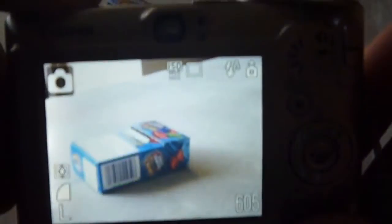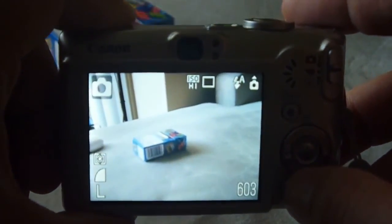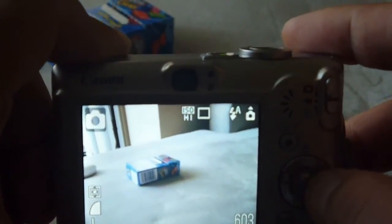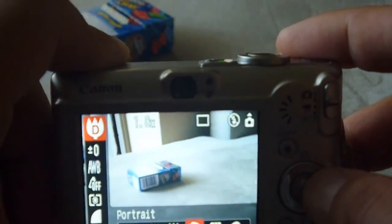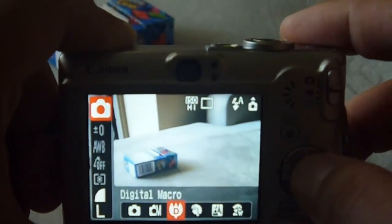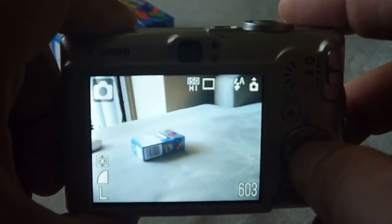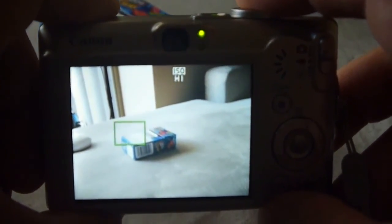Now when I take pictures it zooms properly. I don't think you'll make this mistake, but sometimes it's as simple as just what mode it's in. I made sure it's not in the wrong mode — in this case it was digital macro. I just press the middle function button, go left two times, and choose auto. That fixed my problem. No more blurry pictures.